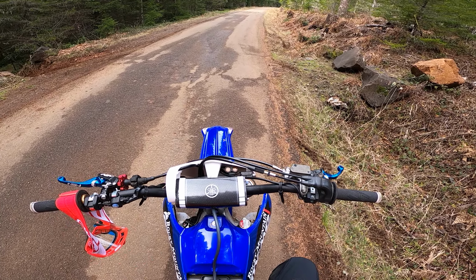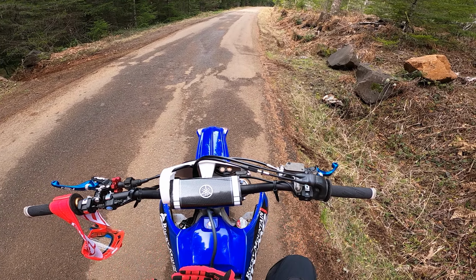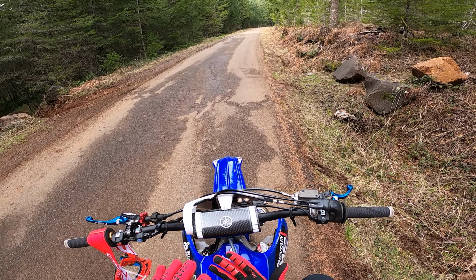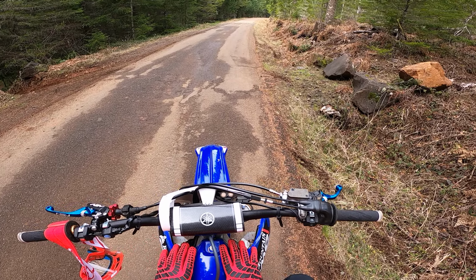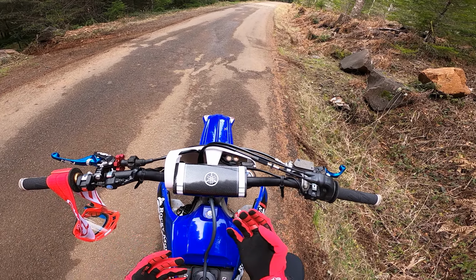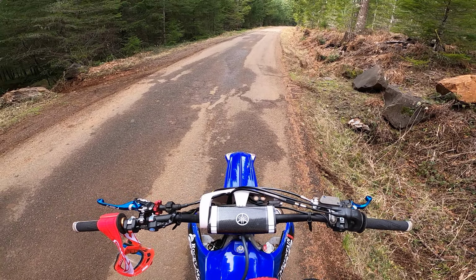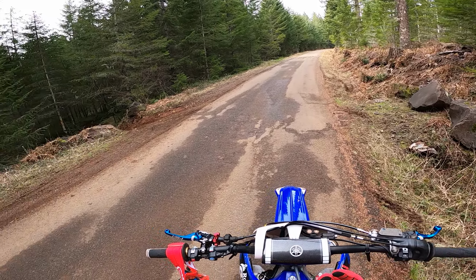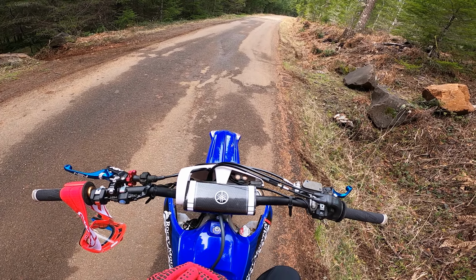So what Twin Air has done is they enable you to take the backfire screen out. You pull the cover off. It has an aluminum frame that holds the filter on top of the other frame, and it just bolts down, so you're guaranteed not to get any dirt in there. Because they eliminated the backfire screen, they put a special texture or coating on the inside of the air filter, so if it does happen to backfire, it won't catch fire.